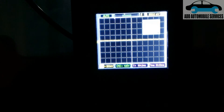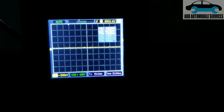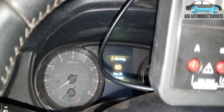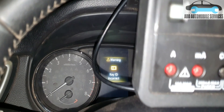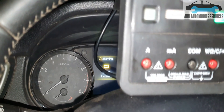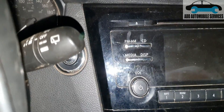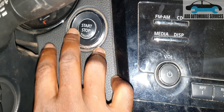I'll go to my scope and press push-to-start. I'm doing this with the key not inside the vehicle. So let me press the push-to-start — and you can see it's requesting for key: 'Incorrect Key ID' or 'No Key Detected.' That means this vehicle is not going to start.